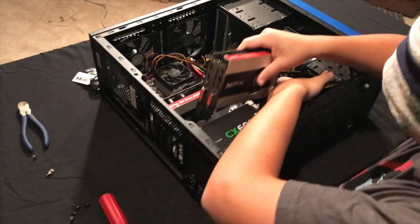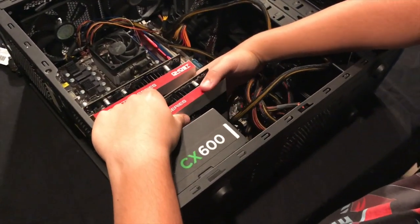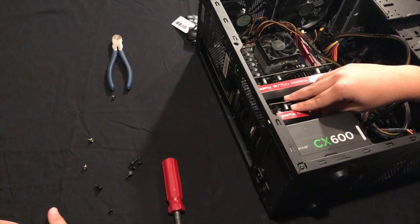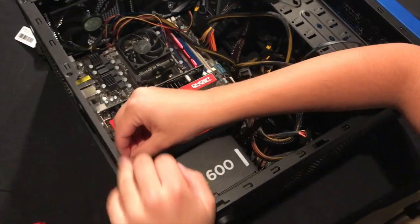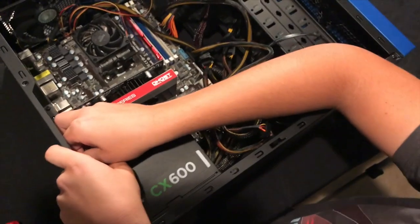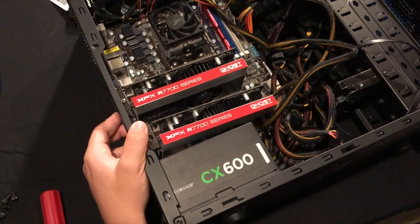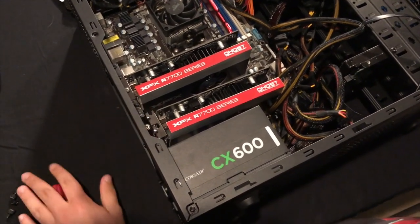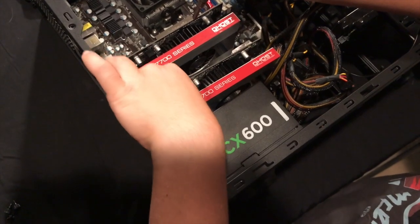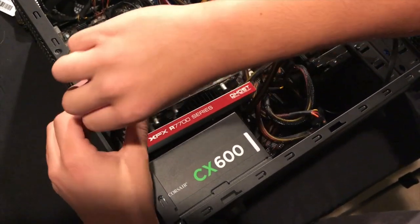One more and side panels and I am finished. This computer is not minimal in design, classic in color, nor does it come with the best features the 2000s have to offer. I don't know if it can run Crysis yet - I haven't gotten it finished. I forgot about front I/O - I was too excited. There's no way I'm going to be able to do the front panel - we're going to have to do that without being blindfolded. I will do the USB 3 header, but audio header I can't do because I don't know which one it is. USB 2 header I can't do either. Front panel connections - even if I find the front panel header, those things are labeled and all identical. There's no way I could do that without sight. So I guess disregarding that, I can build a whole computer blindfolded.